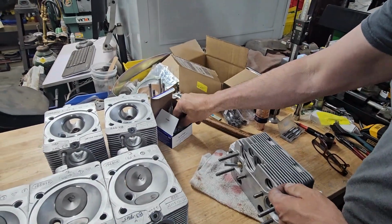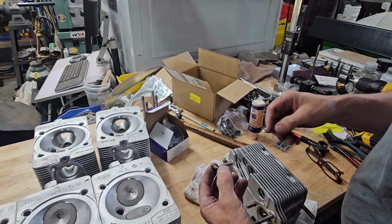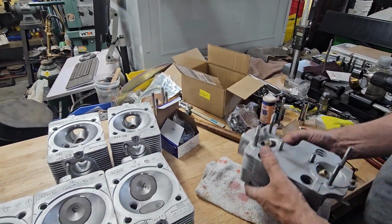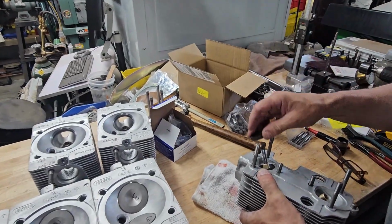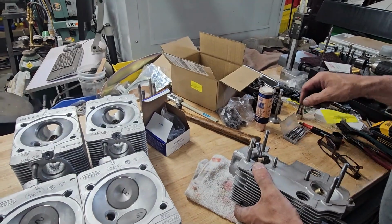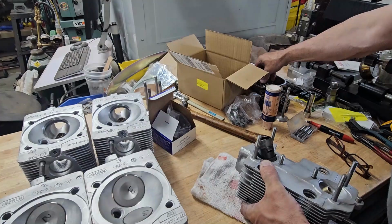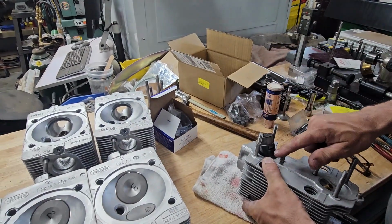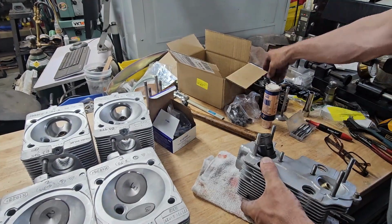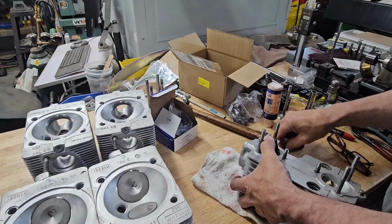And on this one, there's a combination of things going on. The turbos run a lower installed, or closer installed, height. It's 33.5 millimeters versus most other 911 heads at 34.5 to 35.5. So there are a couple of things with the shims that I'm adding, because A, the valves are being cut, and C, the seats are being cut, so that's moved everything in this direction. We still need to confirm our installed height because we've checked our spring pressure at that. So it's going to take a few more shims, which is not an issue.